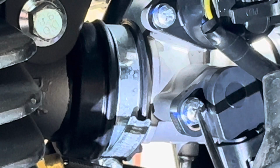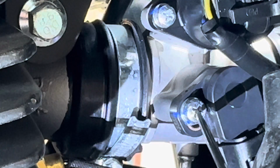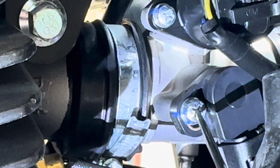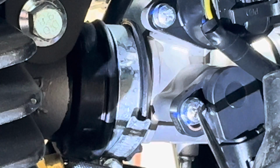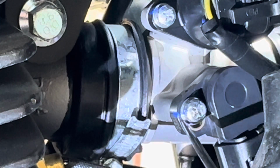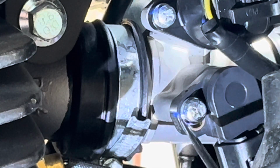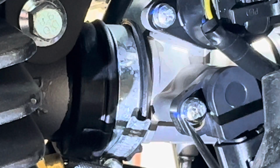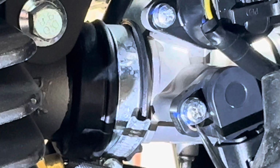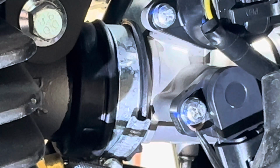If you need to adjust this, you can set it with your scanner. If you want to know how to do that, I'll leave a link in the description to my video on my KPM where I showed how to do that. But if you're in this position, like what I am right now, then you're going to be 0.0 on your throttle position, which is exactly where it needs to be. If you don't have a scanner, you can kind of eyeball it, and you can see how much space I have between my bolt and the bottom of this adjustment right here.